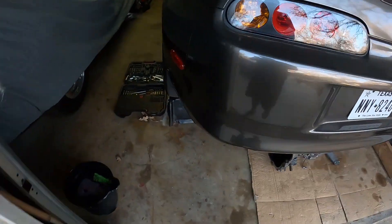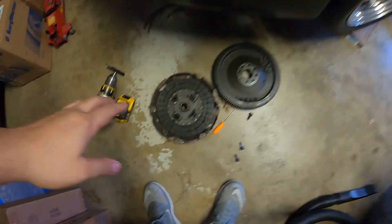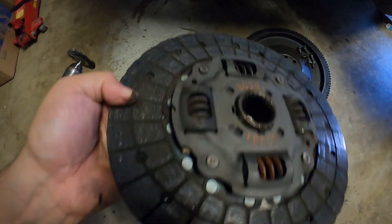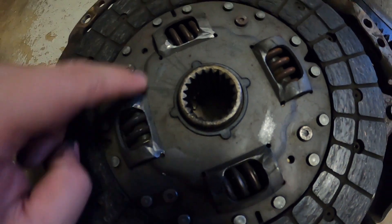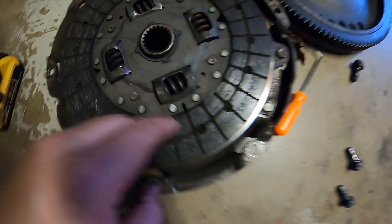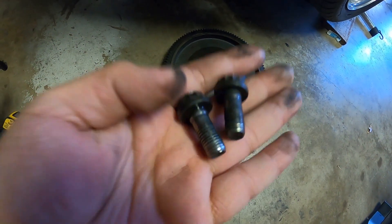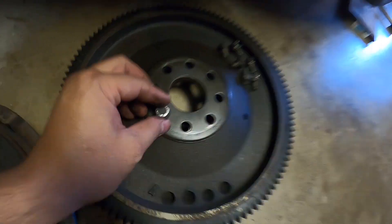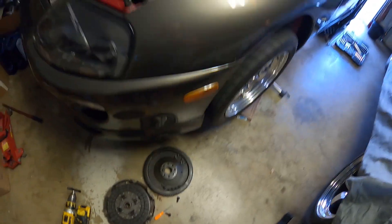After a few days fixing the issue, let me show you guys what happened. This is like an eBay-style clutch. The disc doesn't appear to be damaged, but whenever those bolts backed out, they were hitting here - you can see where they were hitting. And whenever that happened, the bolts - they're supposed to go straight, but they were slanted - so it damaged the threads inside the crank.